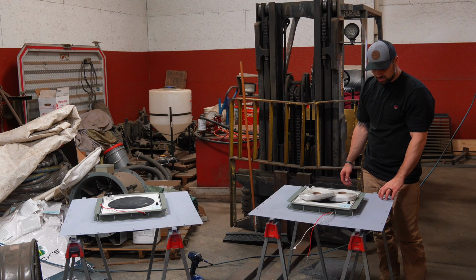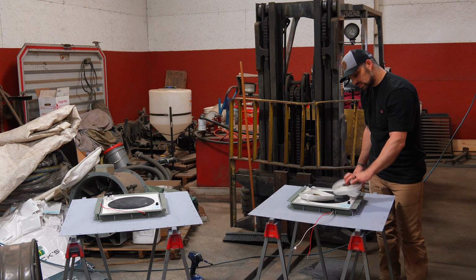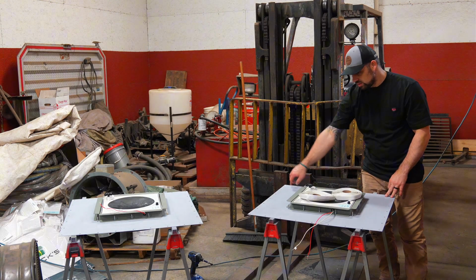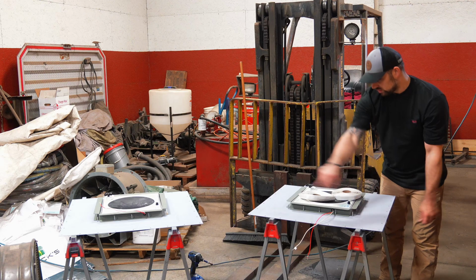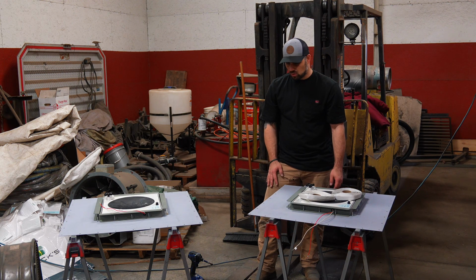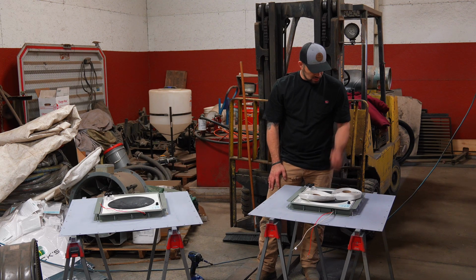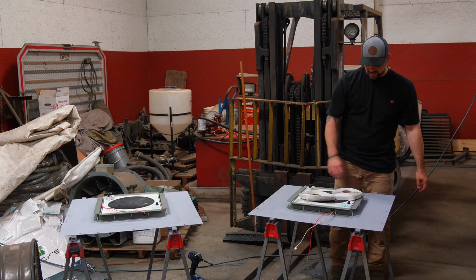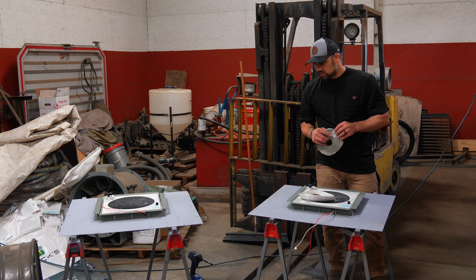So I have the vent fan assemblies flipped over now. I'm gonna go ahead and put the butyl sealant stuff on the actual panel. I'm probably gonna double up along the edges, and then we're gonna caulk around the edges and the rivet holes and the actual frame of the fan too. So try and make this thing as waterproof as possible. And then we'll get them up on top of the bus. But that's what I'm gonna do now, is just lay down all this adhesive sealant and get these things ready to go.